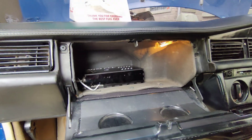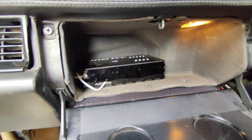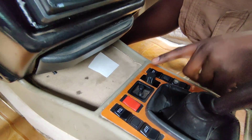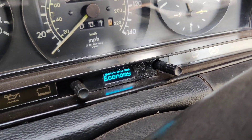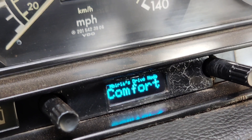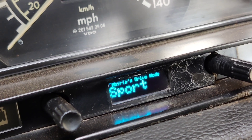That's the main computer — the ECU — that now governs how the engine will run. And then here we have the drive mode knob down here; this is the one I use to change how the engine will respond. The display tells me which drive mode I'm in. If I change the knob it goes into comfort, which means it has changed the fueling and the ignition advance. Then it goes to sport — now it doesn't care about fuel economy but power, giving maximum power that the engine can produce.